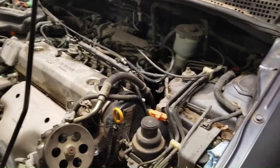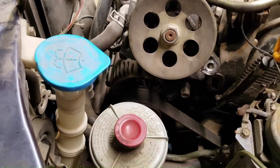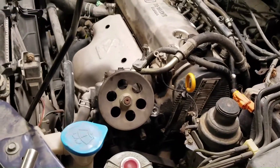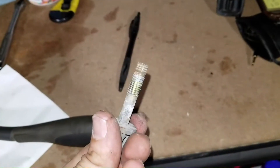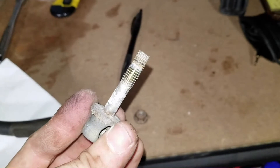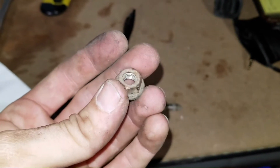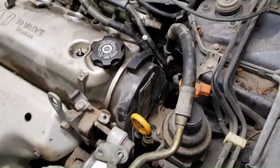The first little hitch: I have the alternator bolt and you can't really see it because it's under the alternator, but so far it feels like it's cross-threaded. I mean, that's to be expected given that it's got 250,000 miles. Got the bolt out and it honestly doesn't look that bad - a little corroded, but either way it's getting a new nut. The alternator is about ready to come off and the power steering pump is off.